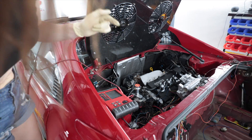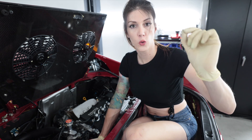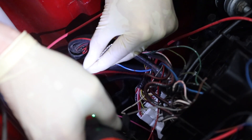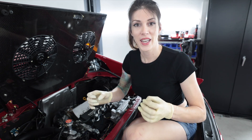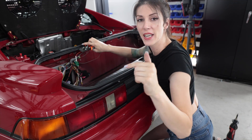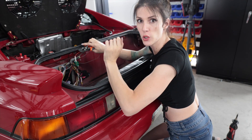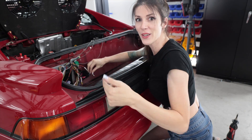There's my wire to my fuel pump. Got it. The circuit opening relay existing wire had a wire that went to the fuel pump resistor — the factory fuel pump resistor and relay. What I'm gonna do is pair that wire to the wire going out to the actual plug to the fuel pump, and once those two are soldered together, the plug on the backside of this new fuel pump relay — the former circuit opening relay — will have the correct terminal for this whole setup to work. I got lucky and had an open port on EA1 on the body harness side for the old circuit opening relay, and the other side wasn't utilized yet, so I'm going to pin the ECU auxiliary output on the other side of it, and now it's all connected.